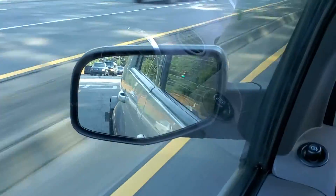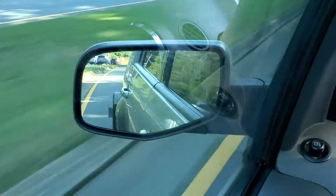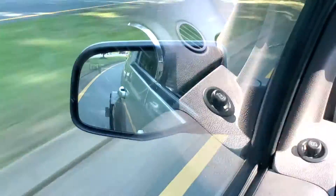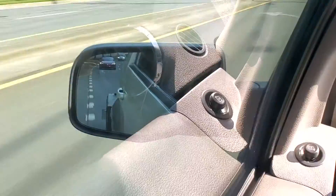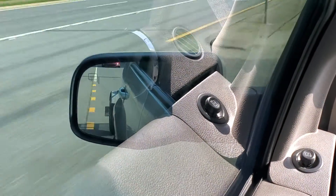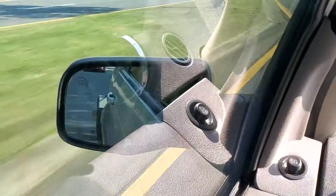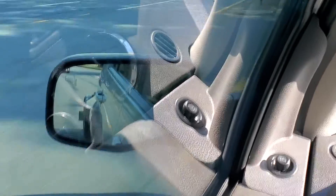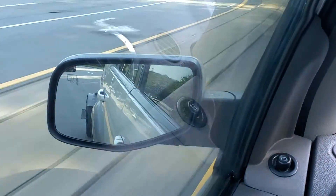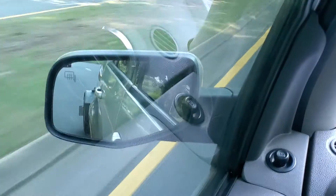The issue is that when you buy these sets, they usually don't come balanced. So I've just got some advice for you: if you buy a set of trailer wheels and tires and you notice that your trailer is kind of hopping back there, especially when it's unweighted — if there's nothing on it — take your wheels and tires to a tire shop and have them balanced.